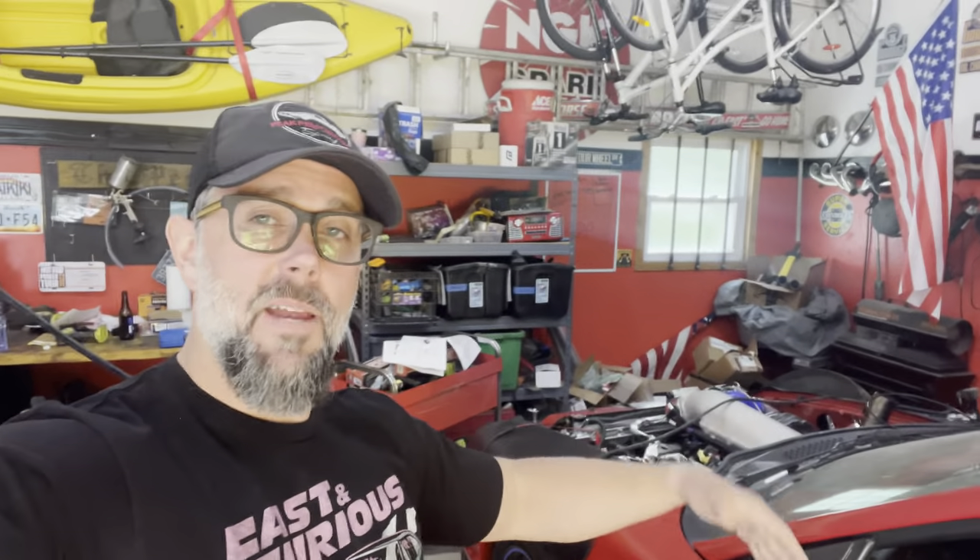Welcome back guys. This is part three of our Holley Terminator install on Project Hellstang, which is our 94 Mustang powered by a 5 liter. It's got a Holley Terminator X, Holley high ram, Anderson N41 camshaft, Pro Comp heads, and a whole bunch of stuff on a three-turbo setup. In the last episode you saw we could not get the car to start — just a crank no start issue. I'm finally back from vacation and got a chance to mess with this thing.